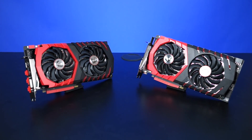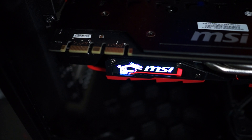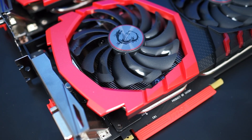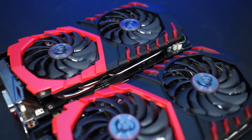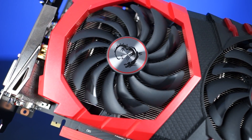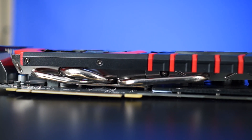MSI's Twin Frozr 6 cooler design remains pretty similar to their previous Twin Frozr 5 cards, like the GTX 970 shown for comparison, with some minor aesthetic tweaks to make it even more gaming-y. There's an LED MSI logo on the top that's actually RGB, so you can customize its color, and all the little lightning bolt-looking doohickeys on the side also light up in red. It uses the Torx Fan 2.0, which looks pretty much the same as the Torx Fan on the 970, but apparently generates 22% more air pressure while reducing noise levels. The fan uses double ball bearings made of steel. There have also been changes to the heat sink — the heat pipes now use a square design as they pass under the heat sink to provide more direct surface area for heat transfer compared to the previous oval design.